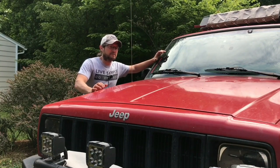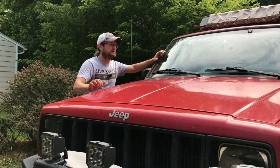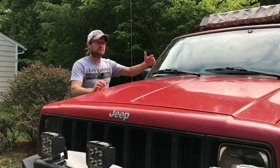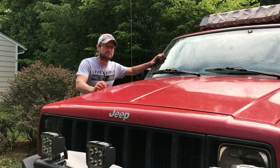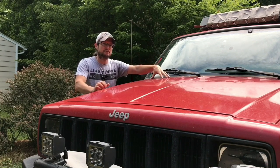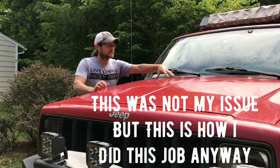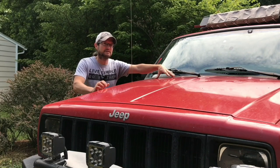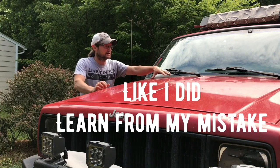In this video, I'm going to show you how I am going to seal the fresh air intake under the cowl on my 99 XJ. I did a water test where my girlfriend sprayed water all over the vehicle, and I looked up in the firewall where the HVAC box meets the firewall and I do have a couple of leaks. It's not coming from my windshield - I'm fairly certain it's coming from the seal on the fresh air intake. So I'm going to remove this cover, cut away some sheet metal, get in there with some RTV, and seal that up. But before I do that, I'll show you a couple of other areas to look at so that you're not doing this job unnecessarily.